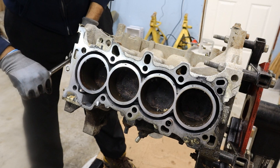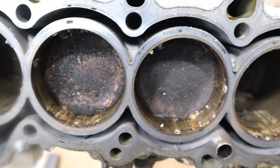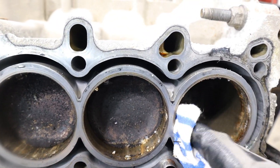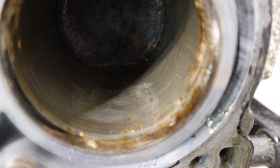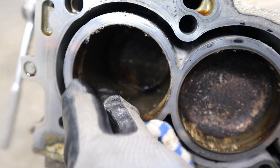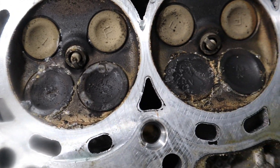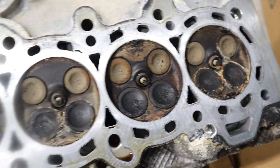Rotating this engine over — it feels very sticky. Looking inside, there are a lot of crumbs in here; the intake was left open sitting outside for a while. Wiping it up, you can see the cross hatching inside is not ideal. It is definitely a high mileage engine. This one's got a bit of sludge sitting at the bottom, a bit of carbon and rust, and the crust continues on the bottom of the intake valves — probably left open when this engine was sitting.